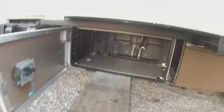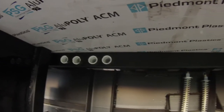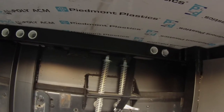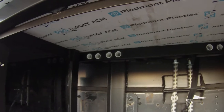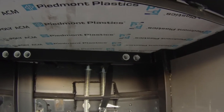This bay is for the heating system. I've got an exhaust hole drilled in the aluminum, and I've got holes drilled through the frame for the heating lines that will be heating not only the coach but the hot water, a preheat for the engine — and the engine can actually preheat all of the above. So those are my feed and return lines for all of those. Basically all I did is drill through the frame and put in a PVC sleeve so I don't have any wear and tear on my tubing.